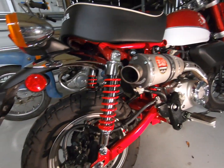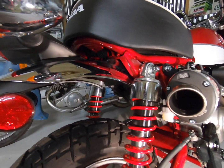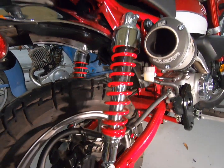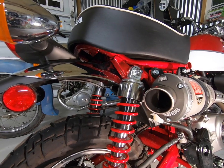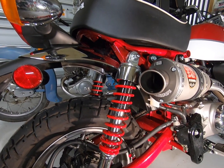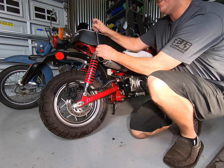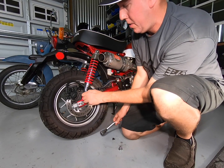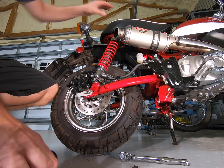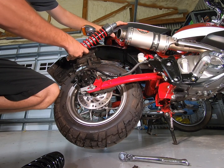Taking a quick look at the rear shock on the Honda Monkey, this is as basic as it gets — a vintage-style dual rear-mounted shock setup with one bolt on the top and one bolt on the bottom. There are no obstructions to getting these off. My plan is to prop it up on its kickstand, pre-loosen these bolts, and maybe stick a block of wood underneath. First thing is to take off the top bolt — it's just a 14mm. Next step is the bottom 14mm. These are acorn nuts; the shocks are mounted on studs. I'll push the bike up onto its kickstand to relieve pressure off the shock, slide it out, and pivot it up to clear the exhaust.